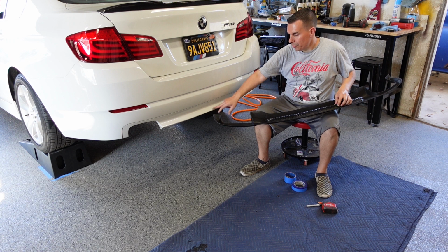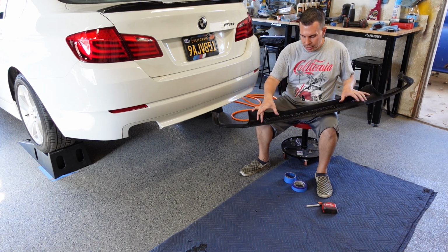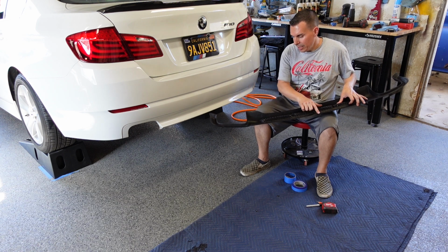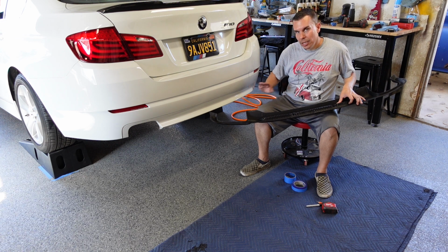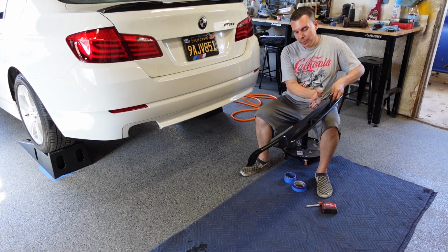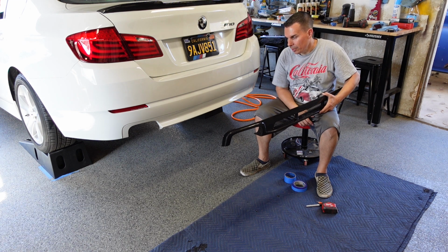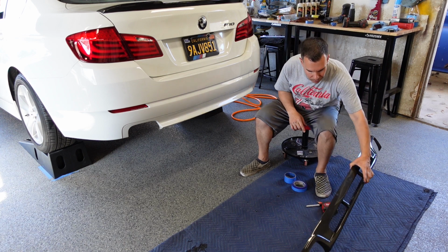So the best thing to do is find your center section of both of these, measure out, see the width and the height of this reference from the center, take that measurement from here, apply it to the bumper cover, and start cutting here. Test fit it back and forth, see if this fits on and up against the bumper, and these actually fit within it, and go from there. So let's start applying tape, taking measurements, and see if we could get this thing to fit.